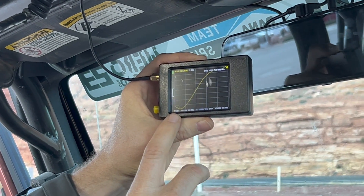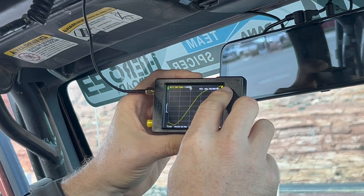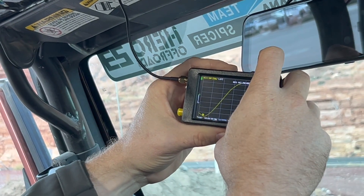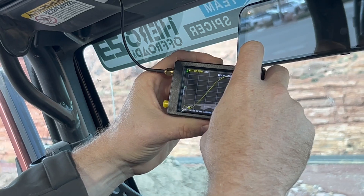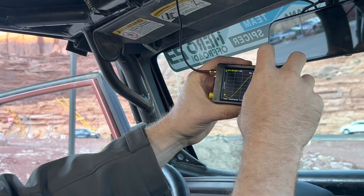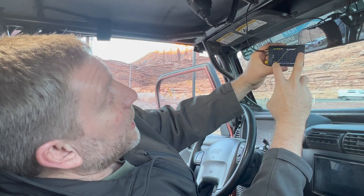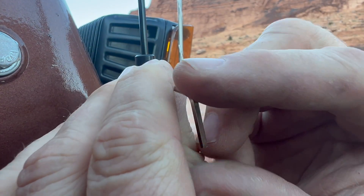With the new antenna connected and running the same sweep as before, we're now at an SWR of 3.063 at the high end of the frequency band — certainly much worse than the 1.8 we had. Coming down, at about 447 MHz we're at a 1.05, so we have a really good SWR at the bottom end of this band but really not acceptable at the top end. Based on the lower frequency being better and the higher frequency being worse, that tells me the antenna is too long. I need to shorten it to move this curve higher up in the frequency band.